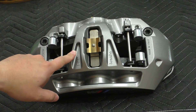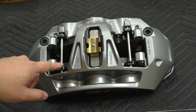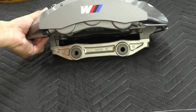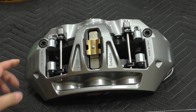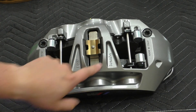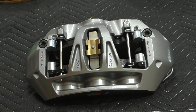The downside of having this fixed bridge is that the pads are not top-loading. So when you change the pads you have to insert them from the bottom, which means you have to take this caliper off of the knuckle and away from the rotor. But having such a thick fixed bridge means that this is a very rigid piece, lending to an overall very solid caliper.